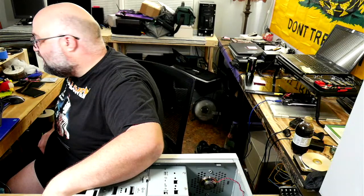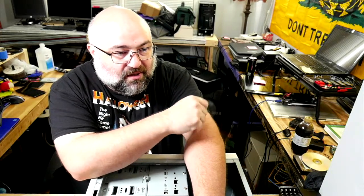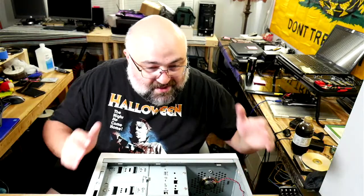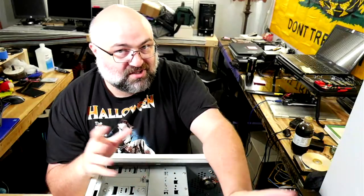Alright. I don't have any of those game systems here. I took them to my studio, but there's not really enough room in the studio to do it, I think. So I'll have to figure it out if you guys want to do the whole classic game thing. But I have the stuff. I'd probably have to capture it all with this mini DV camcorder. Yes, actually, it does require an RF modulator. The Atari, I think, only has RF modulation. I don't think it has composite video. So I'd probably have to get an RF demodulator. Fortunately, people have been bringing me old VHS, DVD, just a bunch of really old equipment and giving it to me because they didn't know what else to do with it. So I have a lot of old composite video stuff. I can daisy chain something together.